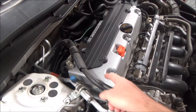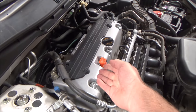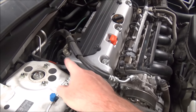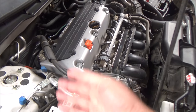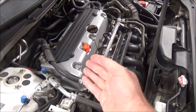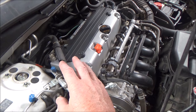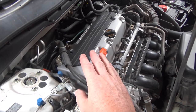The VTC actuator is the piece that goes bad, and typically the fix is to replace it, which involves pulling the intake cam out — so it's a decent amount of labor. Since both the VTC and VTEC solenoids are controlled by oil pressure, we want to make sure we're changing our oil often, otherwise that can cause issues and expensive repairs. Also, that timing chain picks up oil from the bottom of the oil pan, so if engine oil drops too low, you can starve the chain of oil, which can cause issues and trigger a check engine light. Checking and changing your oil often can definitely prevent a lot of expensive repairs on this engine.